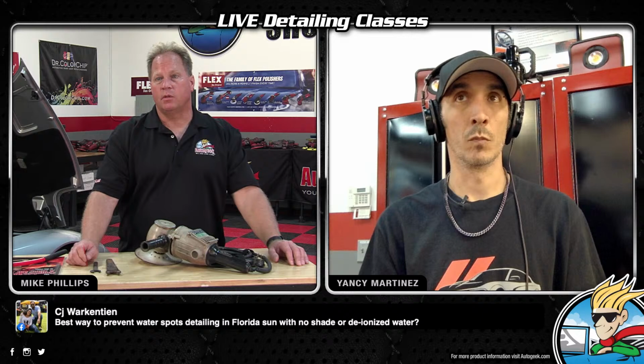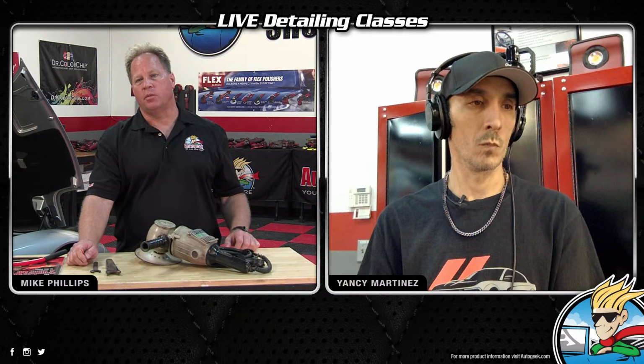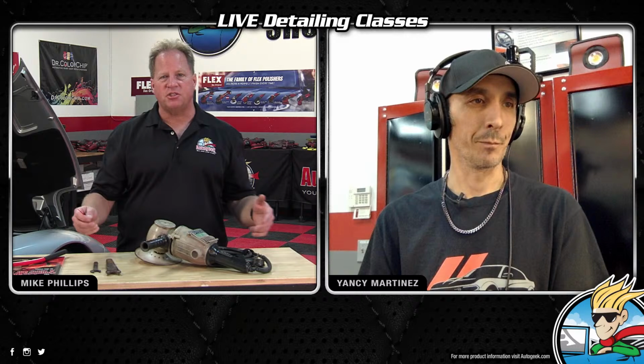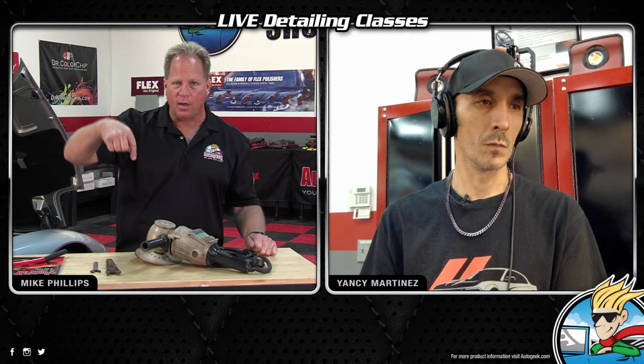You know, the only way to wash a car and not dry it off is to have some sort of filter system. But I'd still dry it off or get a leaf blower and blow it off. Put a coating on the car and put a leaf blower on there and blow it off. But again, if you're running into water spots, here's what you want to do. Ask yourself, what is in the water? What's in there that's so corrosive it's etching urethane? Urethane paint, that's modern base coat clear coat technology. Urethane paint's pretty stout in and of itself. So if you've got something dissolved in the water that's etching holes into the paint, what's in that water? My gosh, you know. Sometimes there's just no easy answer.